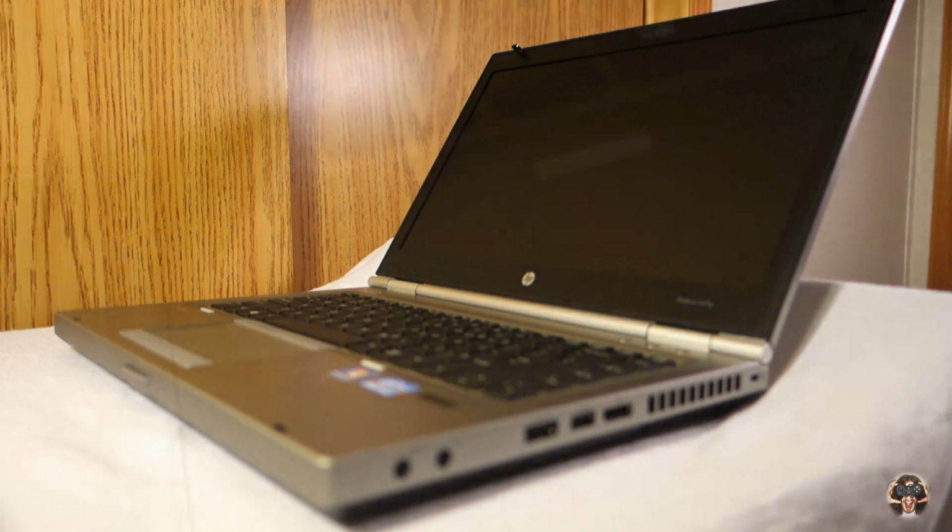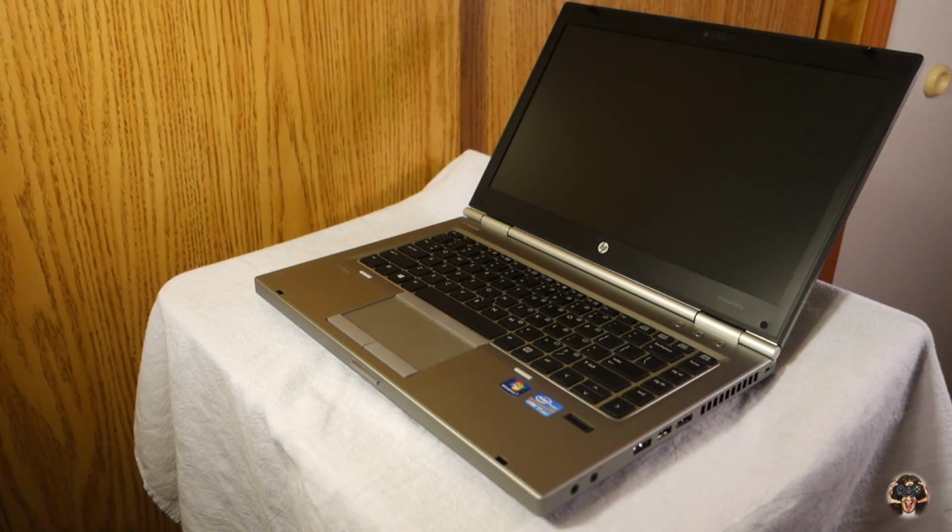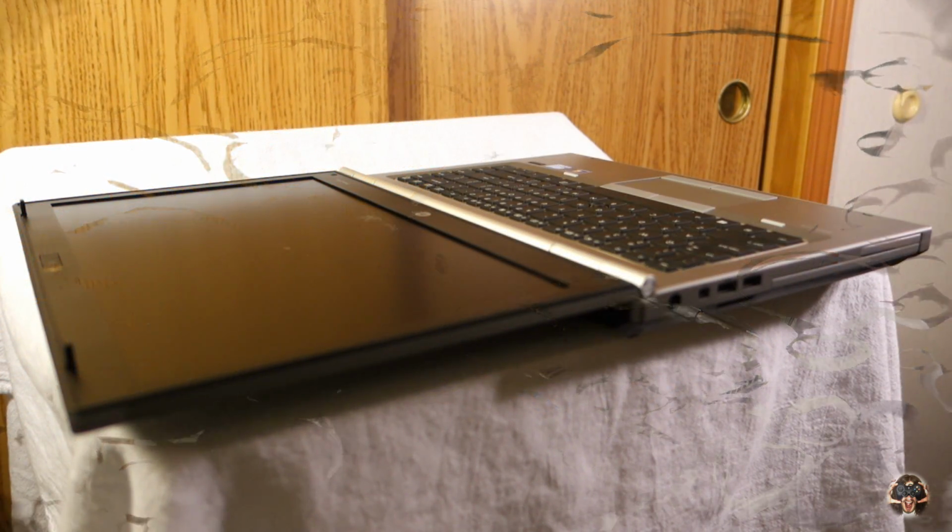On a more serious note, getting an EliteBook with a dual-core i7 isn't something you should overlook if all you need is something light to do your homework or office work on, some web browsing on the side, and some light gaming. Bump the RAM up to 8 gigs, throw an SSD in it, get a 1600 by 900 screen, and hey, you've got something that will give modern laptops a run for their money, and you can use it for light gaming. Very light gaming. And if your luck isn't as good as mine and you get one with a crappy battery, it's replaceable, so yay!